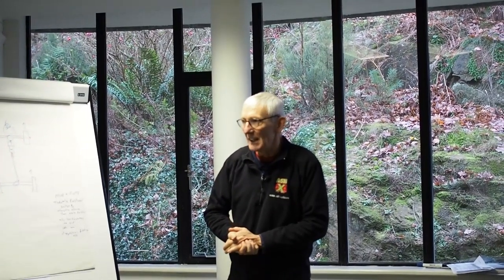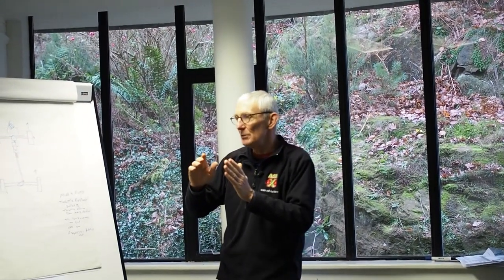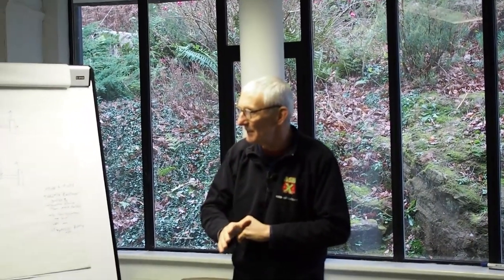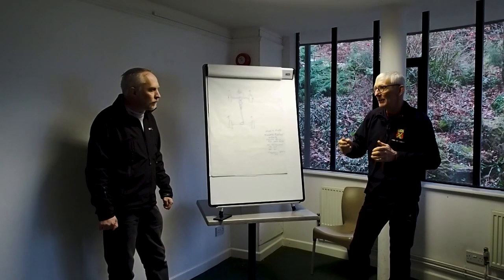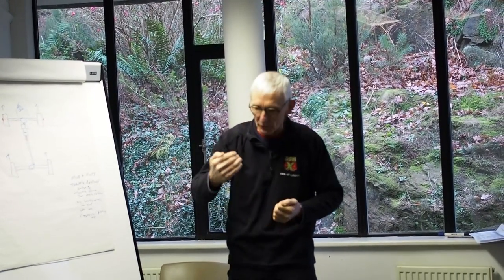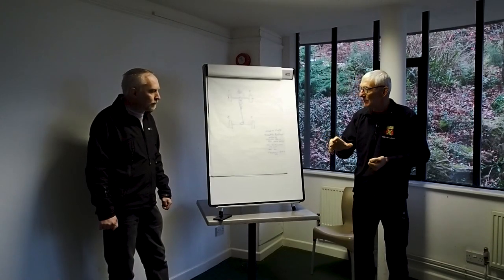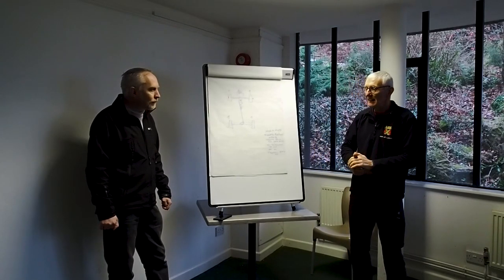Mud and ruts - I have a nickname for it when taking people around to help them remember. I call it the cannabis setting. The vehicle is chilled out and relaxed. Remember we spoke earlier about moving from general to grass, gravel and snow and it moved up to a 7? Now it's down to a 3. There are a number of reasons why. When driving through mud, especially thick gloopy mud, the vehicle is going to slide from side to side, wheels are going to spin, and we want to push through - we're not going to go through in a nice controlled straight line. That's at odds with what the vehicle's built to do.